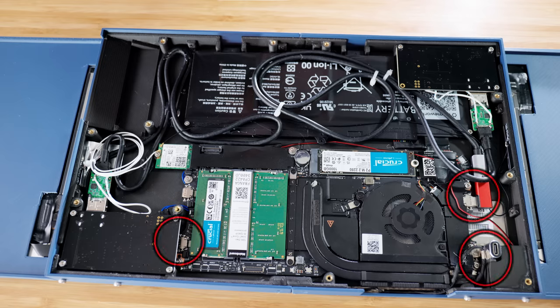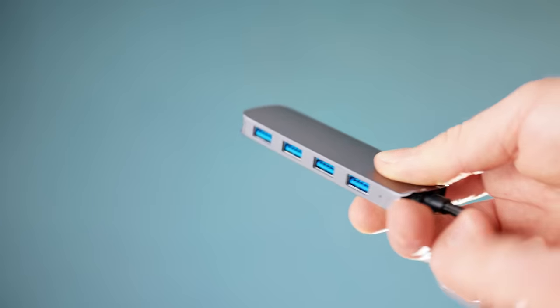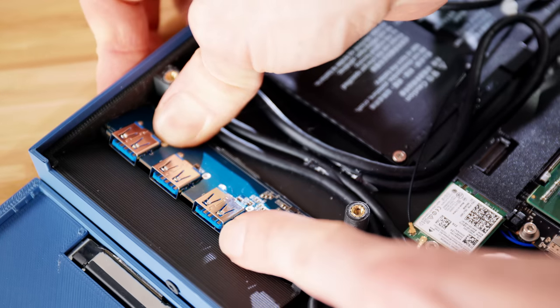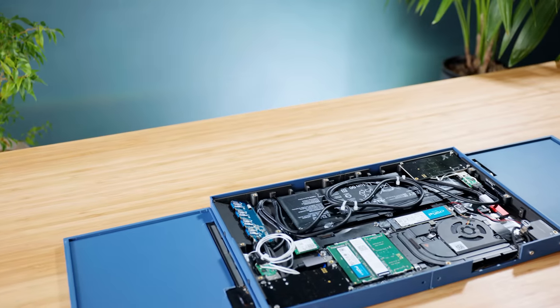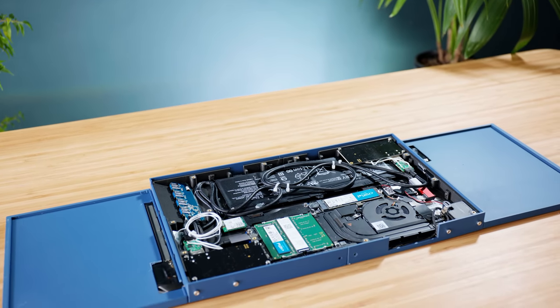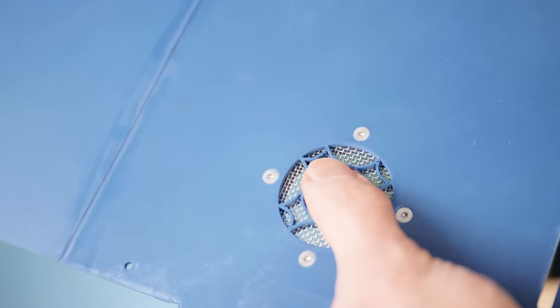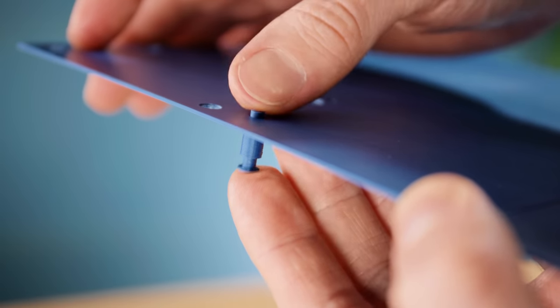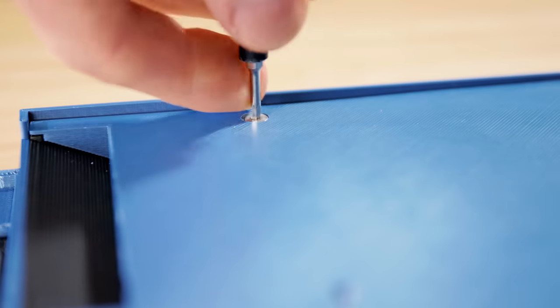As we've used three USB-C ports for both the displays and a power input, we're left with only one spare port, so to get the most use out of it we need to use it with a USB hub. I've somewhat mangled its casing to get the PCB out, which makes it just that little bit more compact once it's glued in place. Its wire is mercifully short, so there's no problem plugging it into the final port on the motherboard. With all the components now inside, it's time to close it up with the back panel, which features a vent for the fan and needs a little grill held in place with a shroud. There's also a through hole for a peg that can push down on the mainboard's power button as desired, and the screws are countersunk so they end up flush.